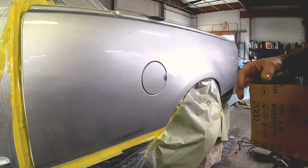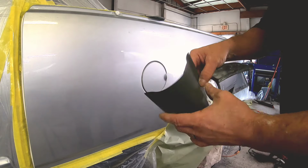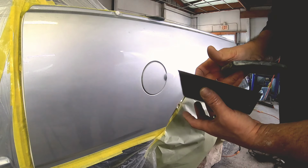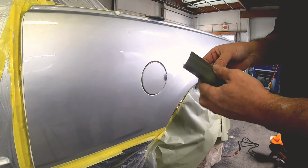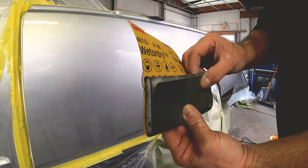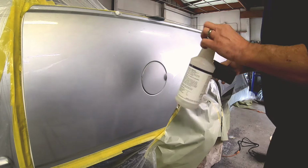So if you don't have an orbital sander with a hook-it pad or a big air compressor, you can do this by hand. You just take some 2000 grit wet dry paper, 3M makes this one, fold a piece of paper over a soft foam block, add a little water